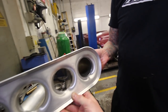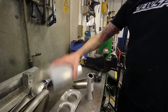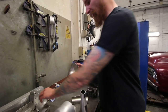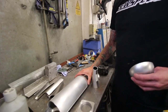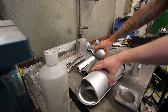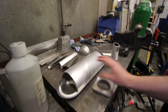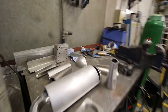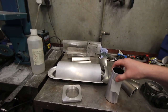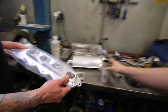You trim them up the diagonal to narrow them, and I had to slightly shape the ends to better match the Zetec port. It'll be welded inside and out, fully ported. Just running four injectors — don't need eight. I'm going for a super shallow plenum on this, getting these half-spheres from LPS Fab on the end. Then it's going to be a tapered dual plenum on top, which you haven't made yet. It's going to look awesome with the really long runners.